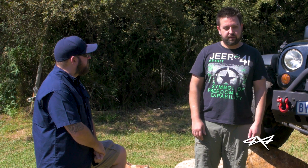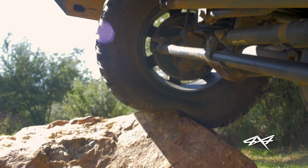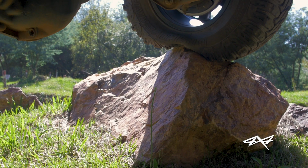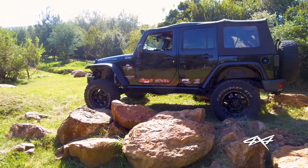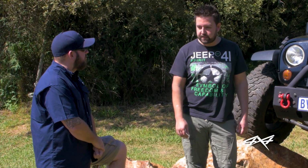Yeah, so putting things on like the drag link flip kits and the suspension geometry parts, track bar relocation brackets, returns the values back to stock, and you get the anti-squat back in. So when you pull off, it's not a boat anymore. It doesn't shake you around. It's restored it. So the drive on this is actually pretty good.